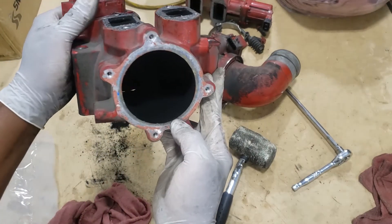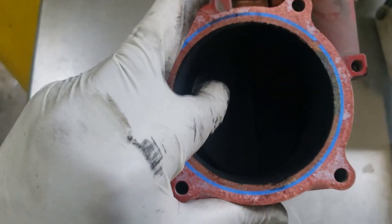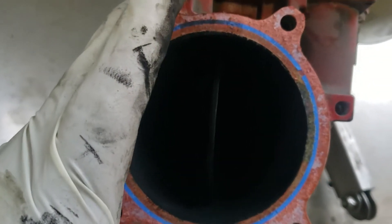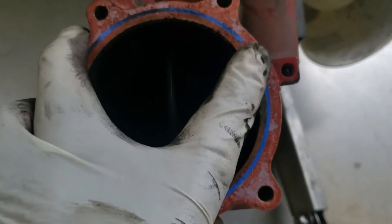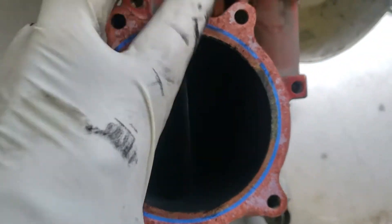From what I can see, it's really not that bad — feels pretty good here. It's not frozen. We're going to clean this out, and at least we know that will be good to go. We're going to have to put a new gasket on here, so we need to scrape along here and make sure everything is perfectly clean when we go back with our new gaskets.